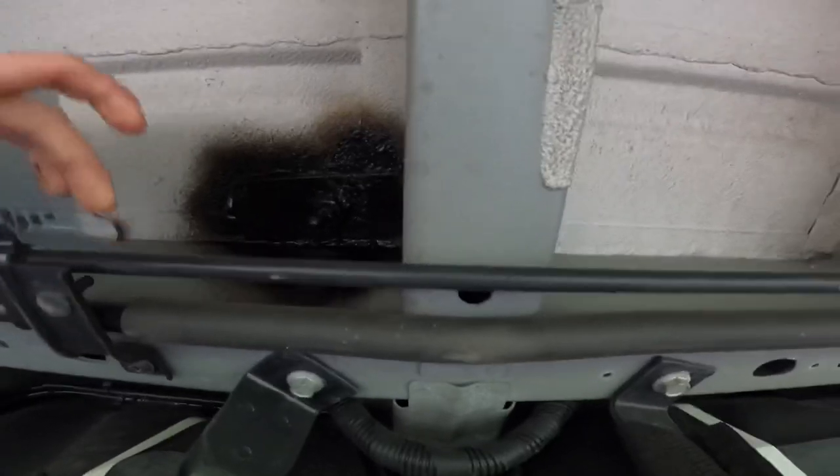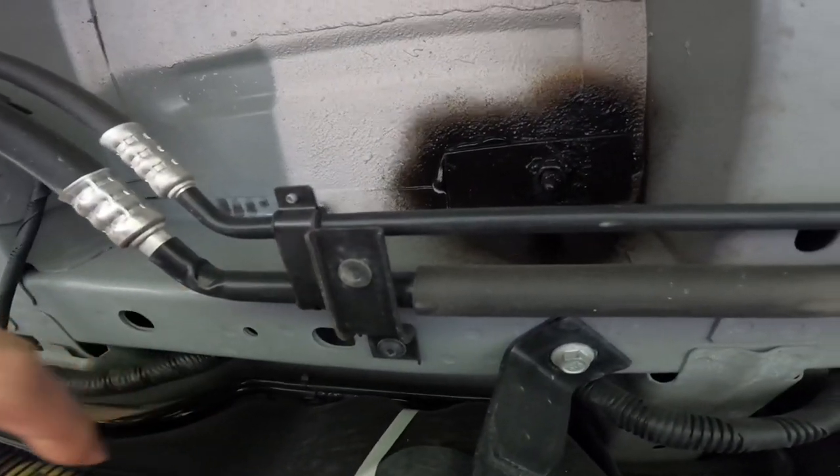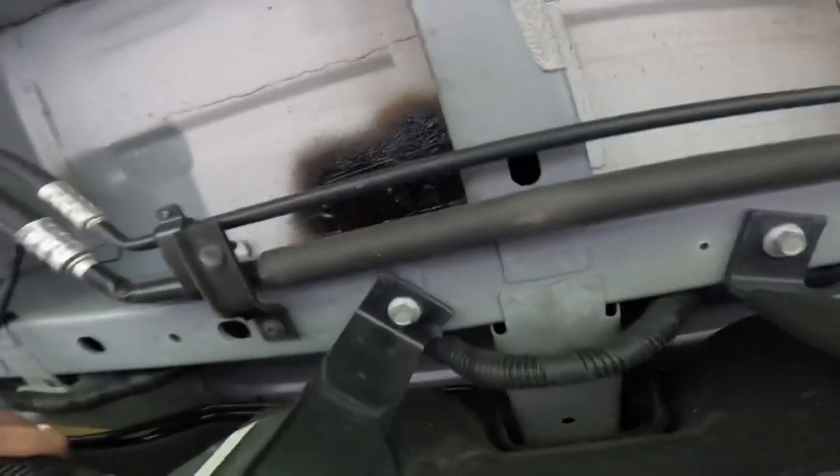This is where it gets difficult. That right there is my hardware, and there's another one back over here but it is under the fuel tank. You obviously have the tank in the way, and all the driveline stuff in the way. But if you get the nut welded onto your steel plate, all you have to do is hold that up there and start running the bolt right through it — it picks up automatically and holds in place. Make sure you're not hitting the frame, the chassis, any lines, the fuel tank, all that good stuff.